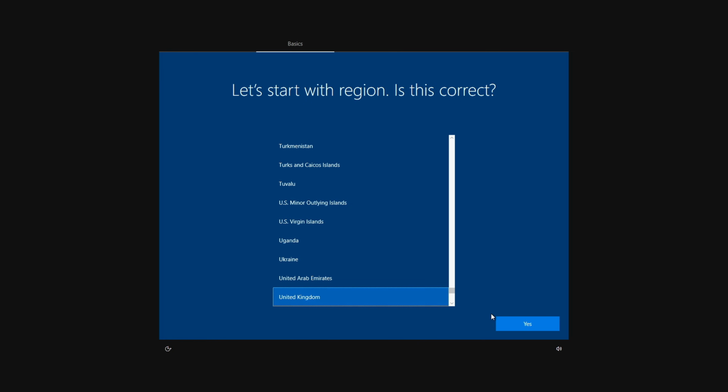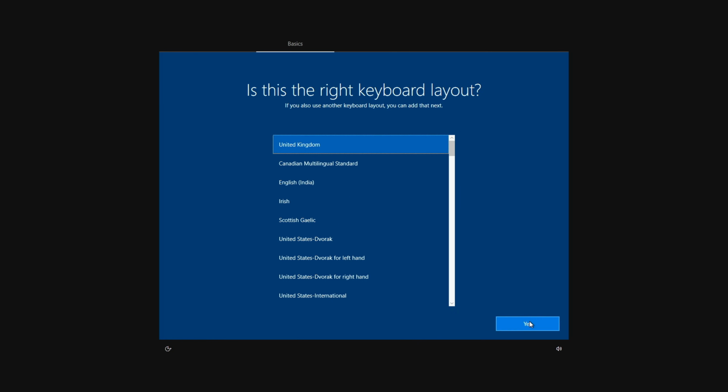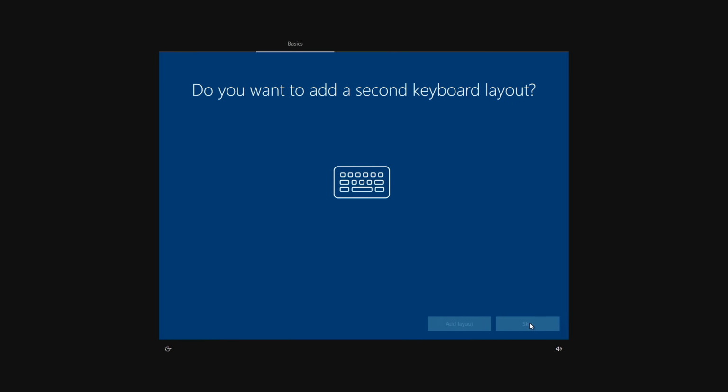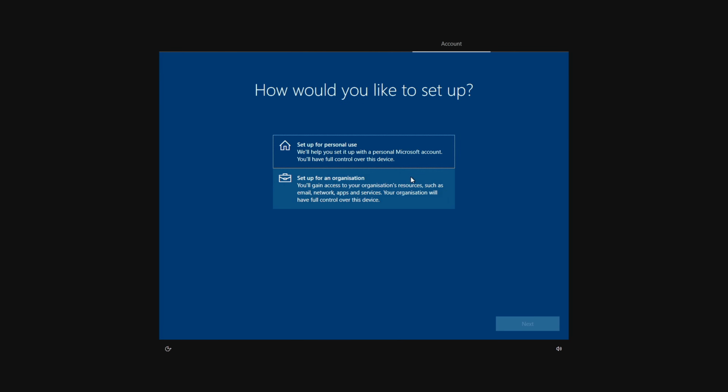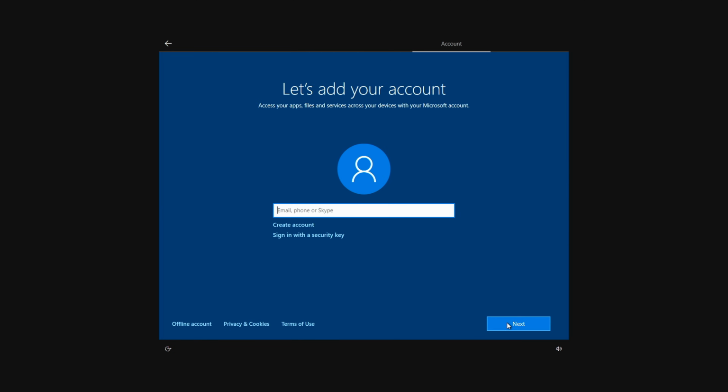Okay, I'm from the United Kingdom. I'm going to click yes and yes again. I'm going to skip a secondary keyboard. I'm going to go ahead and connect to the internet, and then we'll click Next. I'm going to set up for personal use, click next. If you've got a Microsoft account, you can go ahead and put your details in here. If you don't have one, you can create one. If you don't want to create an online account, you can create an offline account.